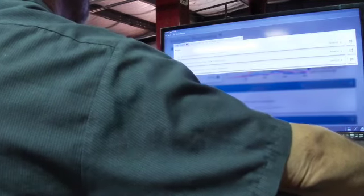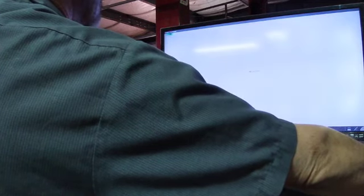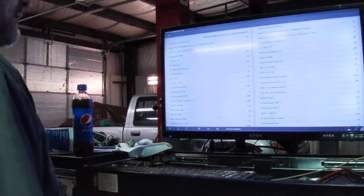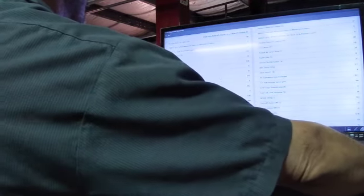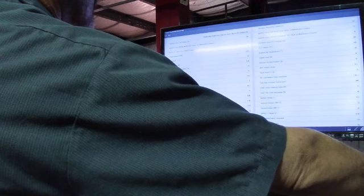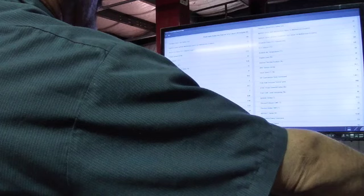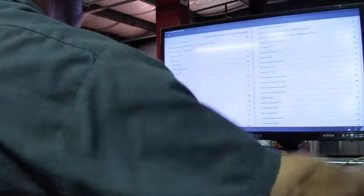Freeze frame failures. We get 2 on the rich lean symptom. Now I'm going to go into this one because this is the only code we've set before, and look at it and see what kind of information we have here. Exhaust cam sensor angle is 22. Desired is 21. Intake is 20. Where's my desired intake? 20. So the intake is actually pretty close.